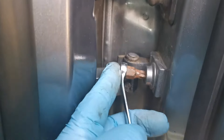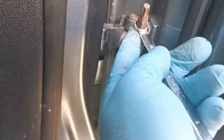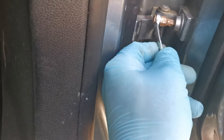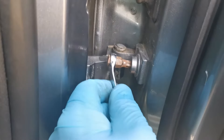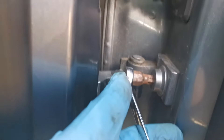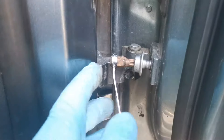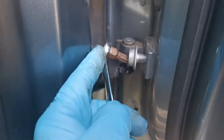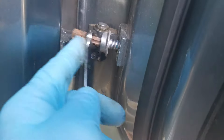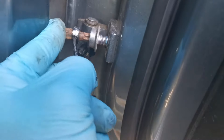Just undo them now. It's a bit tight for space in here, so what I'm using is a T45 bit with a 10mm spanner to get in there. I have T45 sockets but I can't get them in there. So this is the best approach — we'll loosen the bolt off first and then the grub screw. It's a bit slow going because it's locked tight on the bolt to hold it in place. It's not so easy to do with one hand, but you get the idea.